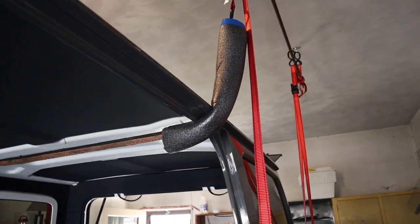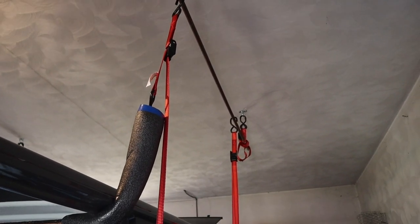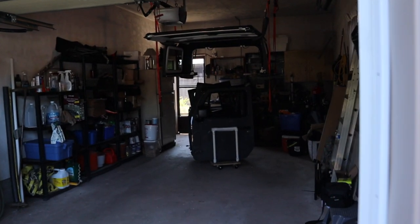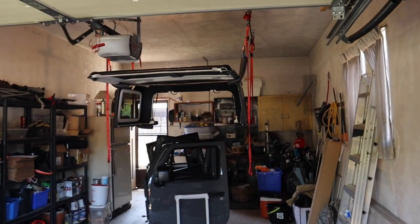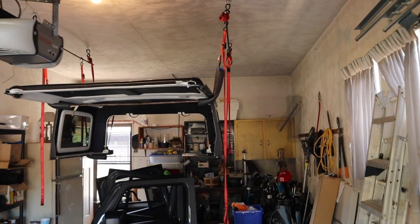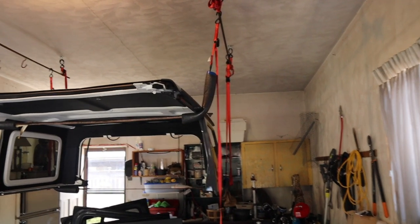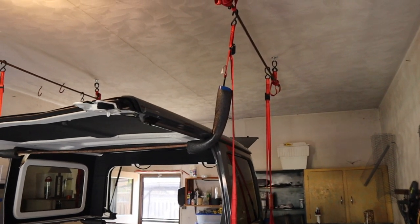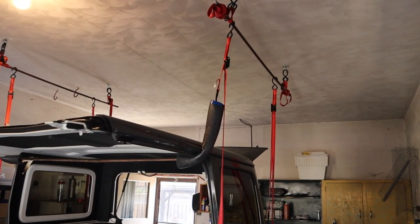Here we are finishing our tour back to the front of the top. So in essence, it's a pretty basic system that involves the purchase of the four cam straps for about $15, and then some hooks for your ceiling. You back your Jeep up, hook up the straps to the top — maybe with a strap covered with foam as you see in our subscriber's example — and then one by one lift the corners up by pulling on the strap and holding the cam button. Then you just reverse the process when you're done: back the Jeep up into the garage, hold the cam button, and slowly lower down each corner of the Jeep, and you're done.